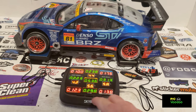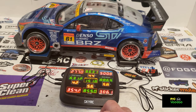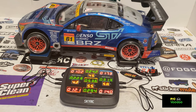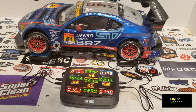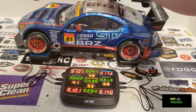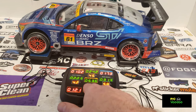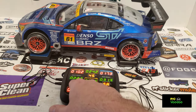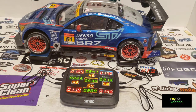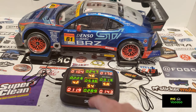What we're looking at: front right 10.2, front left 12.1 — so I'm a little heavy on the left front. Right rear 17.3 and left rear 14.4. This top number gives you the weight percentage on the right side: 45% of the weight is on the right, 55% on the left. Front weight is 42% and 58% on the back, with a total weight of 53.6 ounces. Combined weight for the right is 24, combined for the left is 28.